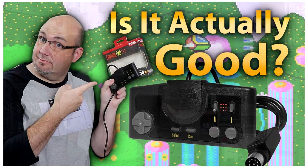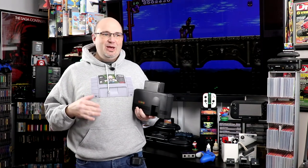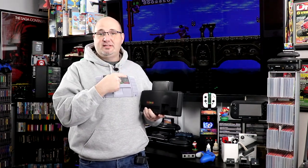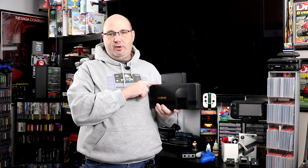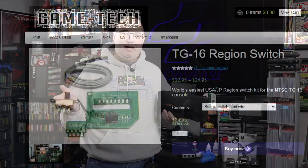And now the latest thing I'm going to do to this is region-free mod it. The reason behind this is the games here in the US, we didn't have the greatest distribution of TurboGrafx 16 games. And the games for the PC Engine, what's playing behind me here actually on my TurboGrafx 16 Mini, great games, physically the same HuCard design, but they were region locked. But you can bypass that region locking with a simple board and switch sold by GameTech.us.